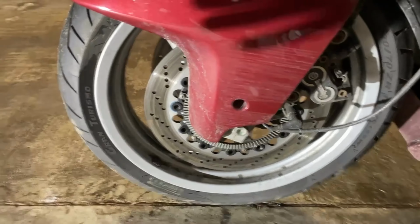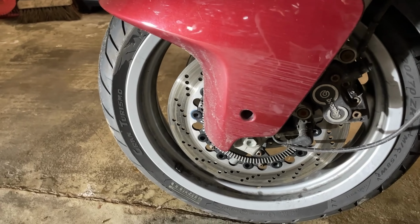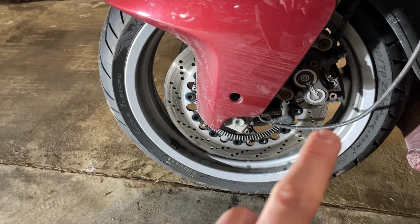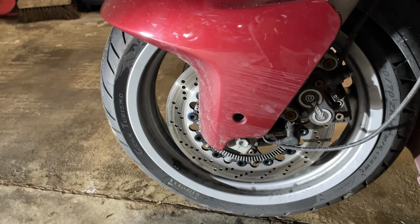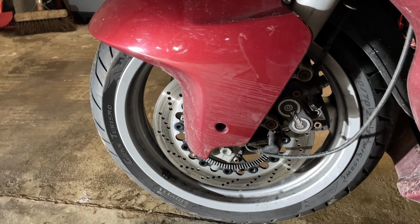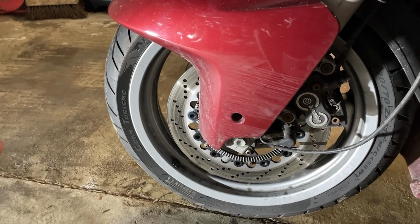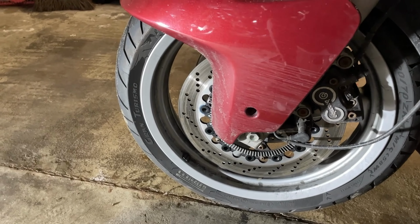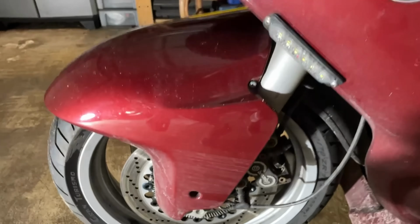But in any case, I have to be aware of this and, like, every time I pump the tires, check it. If it gets worse, if the brakes also keep wearing in the wrong way, then of course I should change them. So my advice is, if you have the problem and it's been ongoing for a long time, don't waste your time and money on the bobbins. Just go for a new disc. If it's just happening to you and it's a new thing, try the bobbins, because then you won't have that extra wear on the rotor and on the carrier. So yeah, that's it.